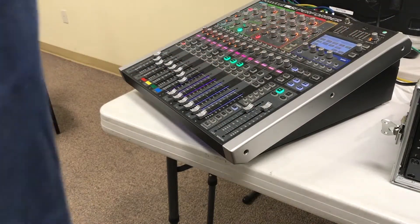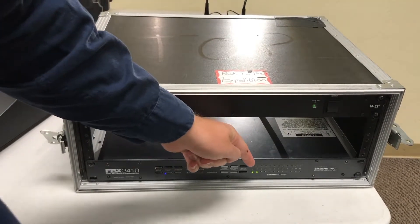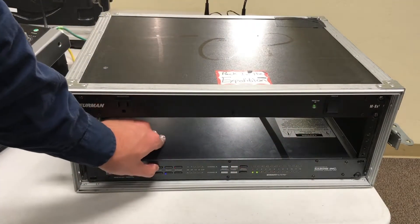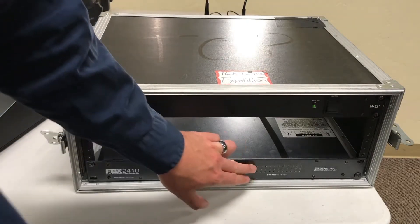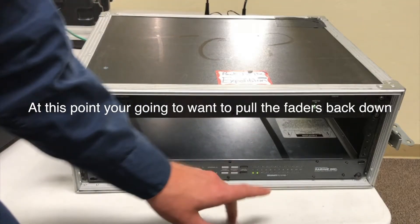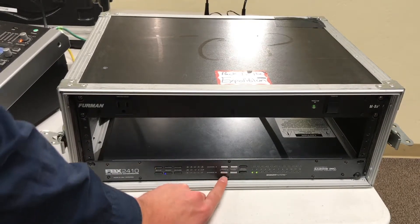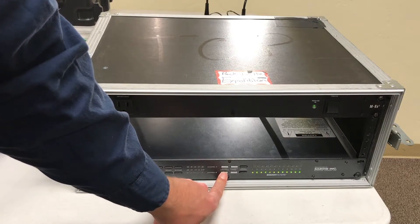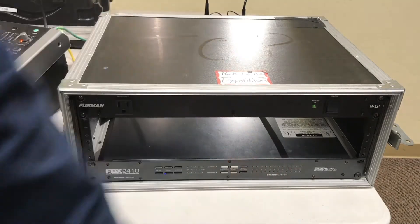While you're doing that and hearing the feedback, on the feedback eliminator you'll see red dots start to count up from one and go up to 12. Once it hits 12, it'll blink and then turn all red across the board. Then, with the bottom row, you go and hit Reset Dynamics — the left silver button — and push and hold that until it resets. Then that will light up on its own during class.